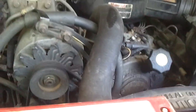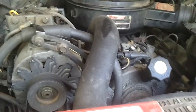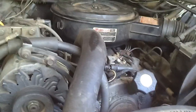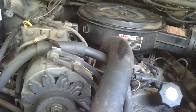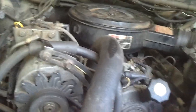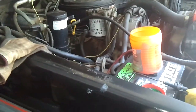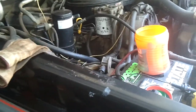So I'm going to take it back to school because it was a little bit low, and evacuate it, just get all the moisture out if there's any in there, that sort of stuff. Other than that, it's working fine. Other than that, the old girl's good. I changed the seal on it, changed the rear seal finally. Got the part and replaced it, so I have to replace my brake pads pretty soon on the back just because one side got oil soaked. Now I'm not leaking any more fluid, and my shifter will stop shaking going down the road because my rear diff was low on fluid.